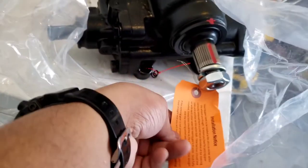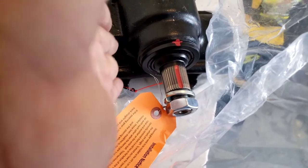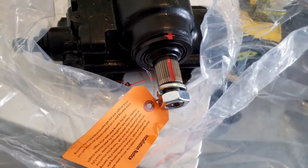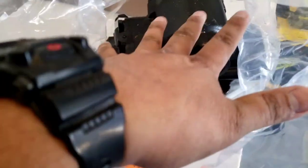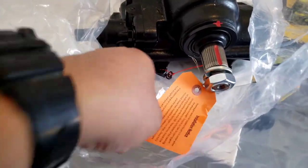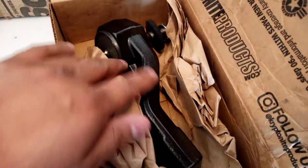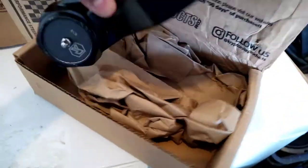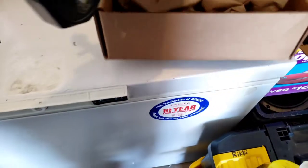It's pretty heavy. I was kind of scared about how you get it lined up — like, 'oh crap, I'm going to be way off' — but this line is center. So if you're installing it, it needs to be installed with the wheel straight. That's what the note says, which is pretty nice. We'll pair it up with the pitman arm, so that'll be done.